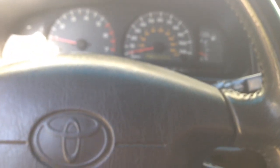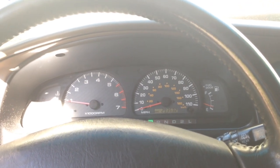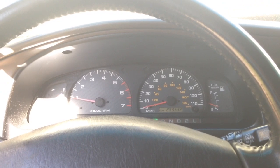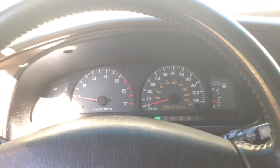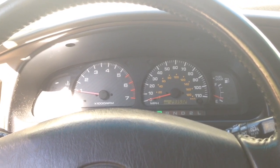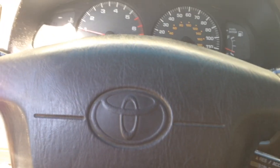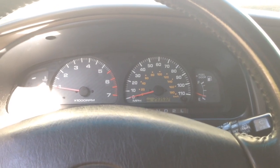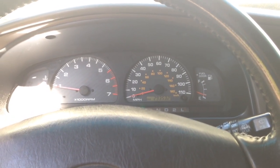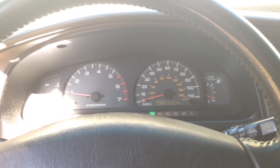All the codes, of course, are cleared out of it right now. And it seems to be working just fine. So, I'm not gonna replace anything until I get another code, because the throttle position sensor seems to be working fine, going by my scan gauge from the previous video. And hopefully the idle problems I had, the idle air control will be okay after cleaning it, because it was pretty gummed up. Anyway, thanks for watching.